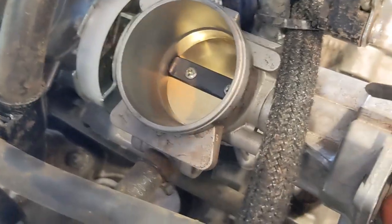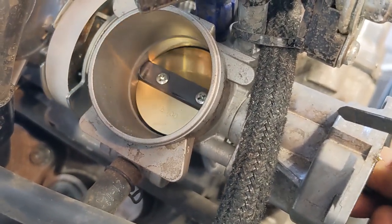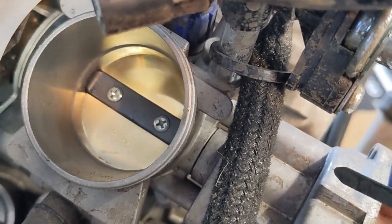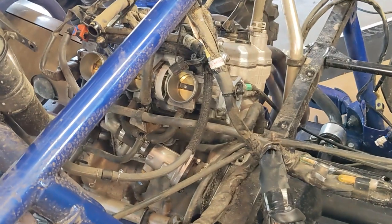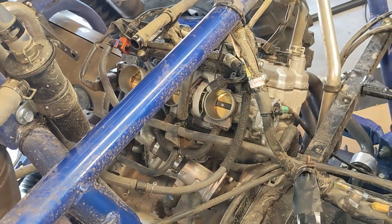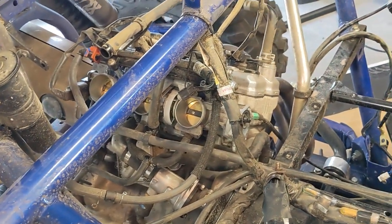I believe that was the issue. As soon as I loosened up the screws in the middle throttle body, the butterflies are no longer sticking when I start to open them — there's no longer any sticking. And watch, if I let it close real slow, it's closing off 100% without me having to let it snap, shutter, or force it. I think the center throttle body butterfly was not centered properly, and that was probably the whole issue. It was getting exacerbated at temperature.